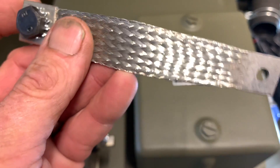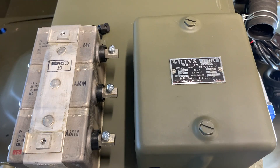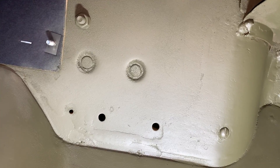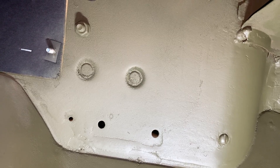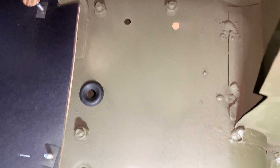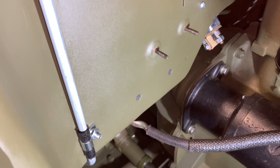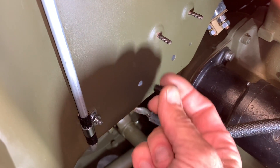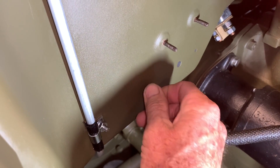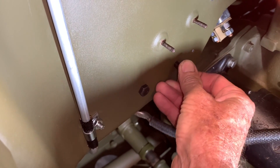This is going to function — it would work if we did have a radio — though the way it's suppressed, this probably wouldn't have been the way it was installed. As I've researched this, there are multiple ways that these units have been installed on these tubs. I'm just going to do a very basic installation, as I've seen multiple times in multiple pictures. On the inside of the firewall you can see the firewall pad, and we've got four holes that are pre-drilled as well as the grommet where the wires are going to come through. Those two studs in the tub are for the junction block.